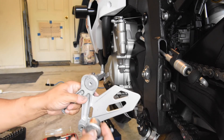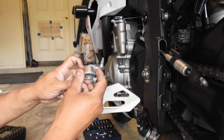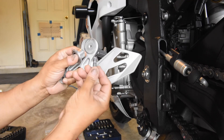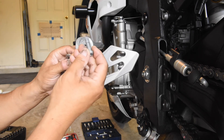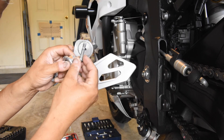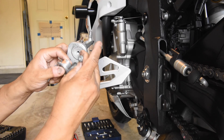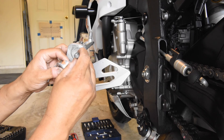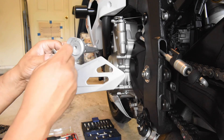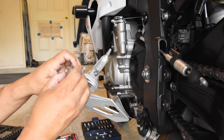After a bit of fighting I managed to get the gear shift lever off. What's remaining aside from the gear shift lever is this bushing and this bolt. This bolt had some Loctite on it — a kind of pink Loctite — and it was stiff, which caused me to chew up the head a little bit, but I can put it back in no problem.